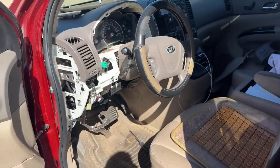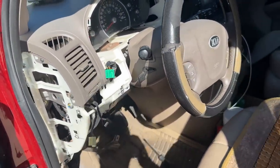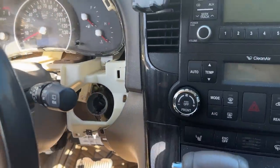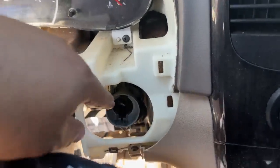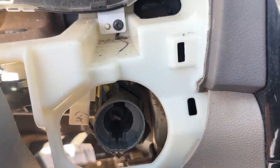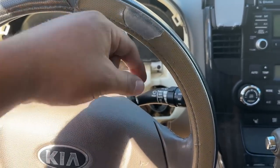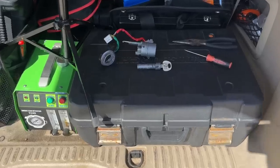Inside the vehicle you can see I already pulled the ignition lock cylinder out. I removed a couple of panels and the little bezel around the cluster — really simple, only a few screws. The ignition is in the dash, and there's a small hole at the top. You put the key in the accessory or on position, then insert a pick tool into that hole to release the lock cylinder.